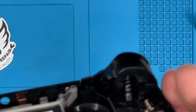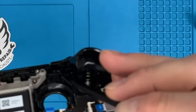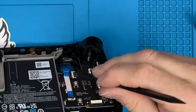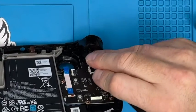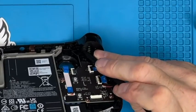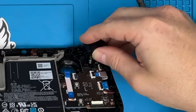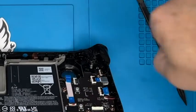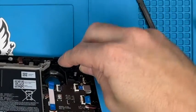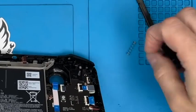If you can see in there, we're going to get inside that lug where it comes down and sits over a little circular spindle. We're going to ping that off, and the button will come out, making sure that we keep hold of the spring. So get in there. There we go. So that's already half off. Put a thumb over the spring, give it a wiggle, and we're looking to then withdraw it that way to come off of the other lug so we don't do any damage. It's quite fiddly because it's tucked underneath there, and there's a spring as well.